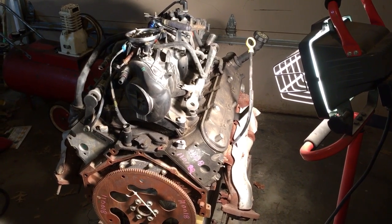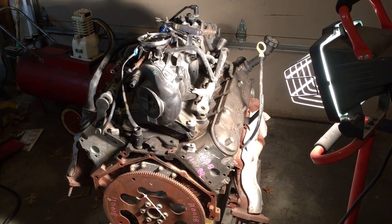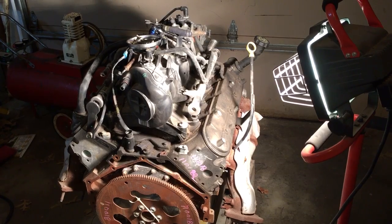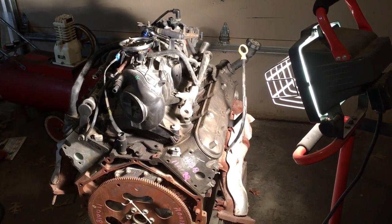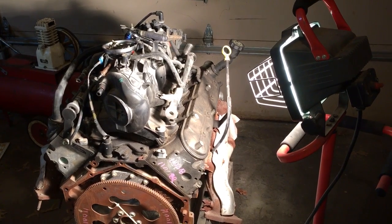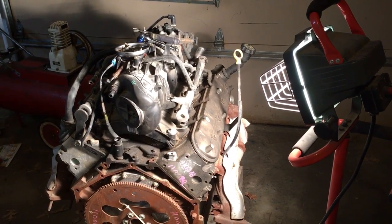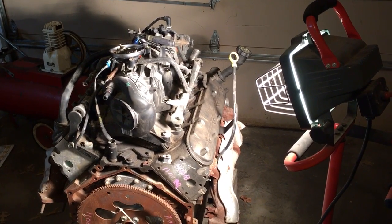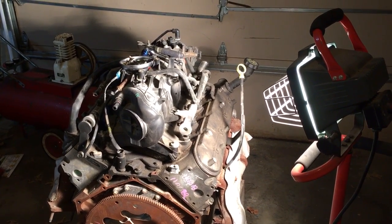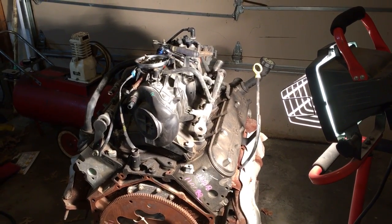I want to have absolute control over my valve train at boost. I have searched the internet and been very unsuccessful in trying to track down a set of Gen 4 pistons and rods for this motor. Apparently you can get them halfway available for the 5.3 motors, but the longer-rod 4.8 Gen 4 stuff is kind of hard to find. If I can get my hands on a set of those big fat Gen 4 rods and floating pistons, this motor will get them — I want to put 600-plus to the wheels. But I will not push a Gen 3 rod that hard because I've seen too many people online with S-shaped bent rods or worse.